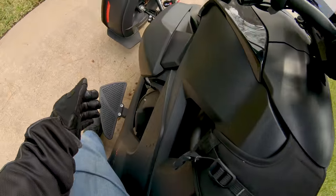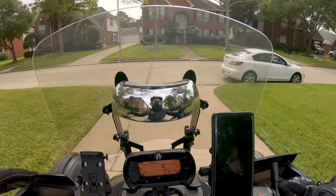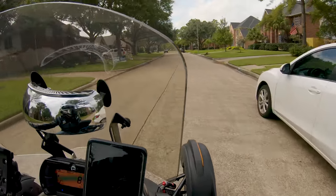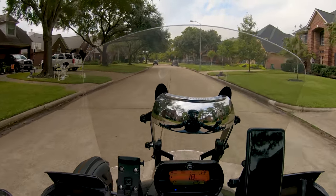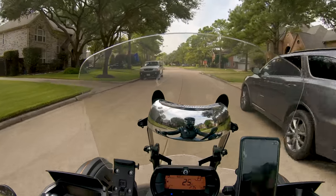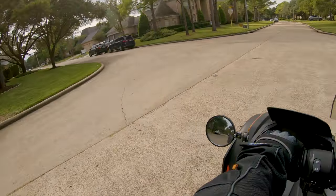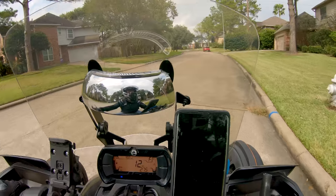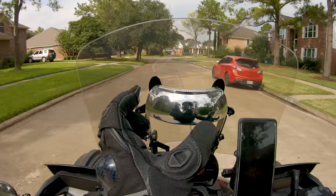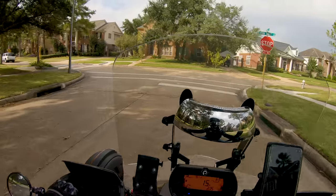I couldn't get the rear nut off the bike. I gotta take it over to Discount Tire and see if they've got bigger breaker bars or impact wrenches than I do. I was jumping up and down on the 3/4-inch ratchet, and I could not break that rear nut loose. And I was even using the plastic sandwich bag trick to keep it from marring the nut, but I need about a 2 to 3 inch extension, 3/4-inch extension no less, to space it off from the edge of the tire, because there's just no room.